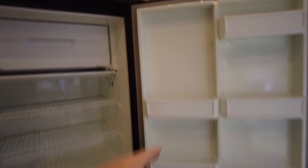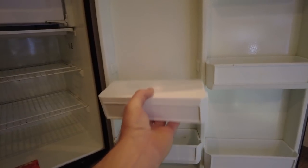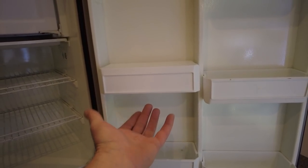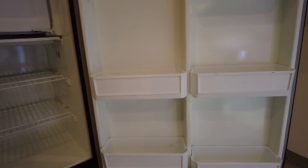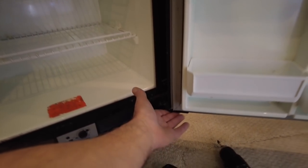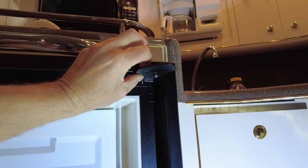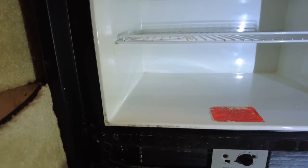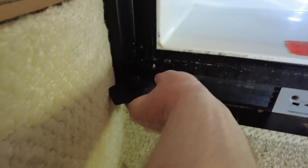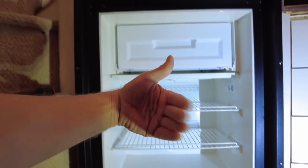While thinking about it, this door is going to have to be flipped upside down to operate the other way. I just checked on these shelves and look at that - the door is now flipped upside down and those shelves will still fit in there the other way, because the door's going to be like that. They thought all that through when they designed and built this. Next I'll take the door off the hinge - a couple of screws at the bottom, a couple at the top. The top hinge will now become the bottom hinge because it has to be flipped, and vice versa, so the door swings the other way.